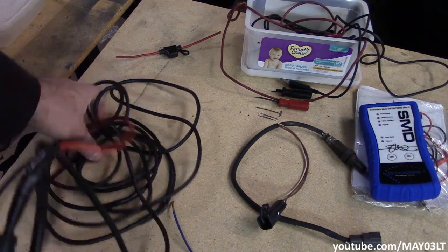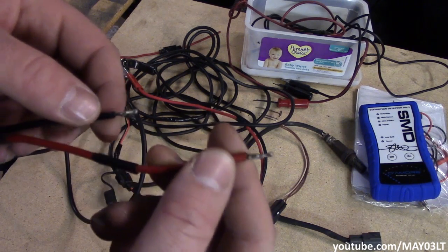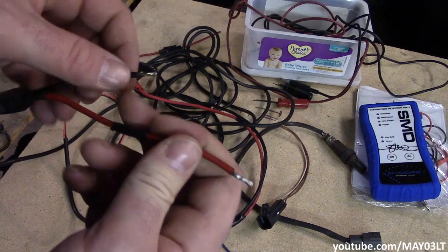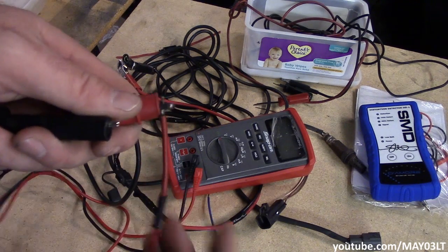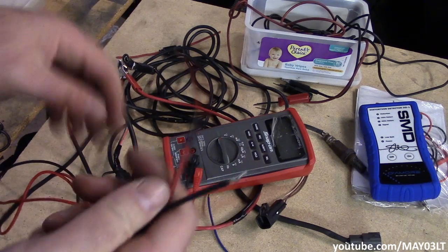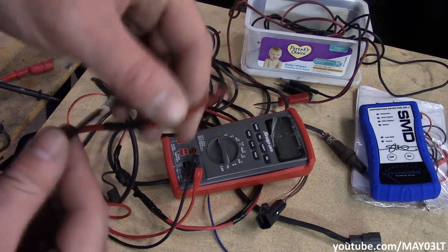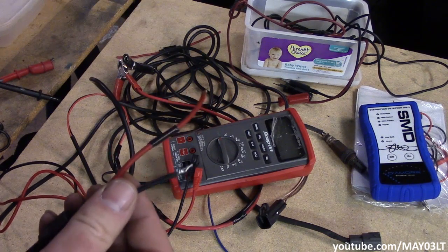When you come off the battery with those leads, the positive wire has one of these little inline fuses so that my test wire is protected in the event something bad happens. At the end of my test harness, I've got a red power and a black ground, tinned with solder so my alligators can get a good bite. I cut the ground lead about three inches shorter than the power — this way they never touch each other, because that kind of wouldn't be good to wipe out our little fuse.